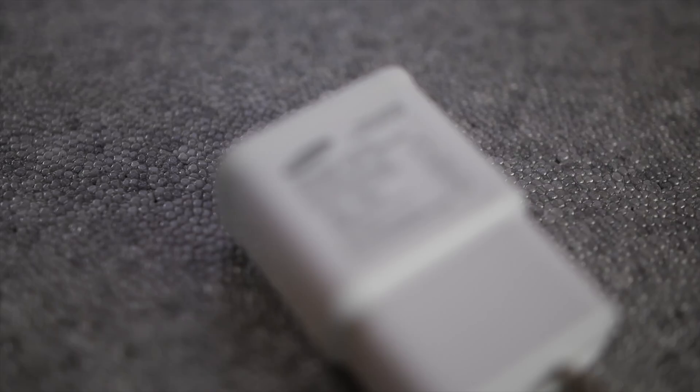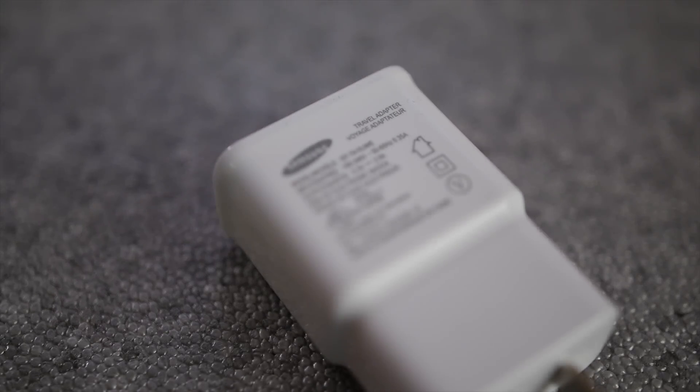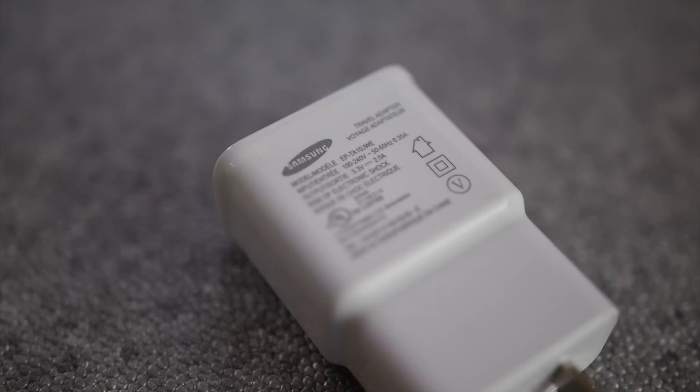So what have we learned from all this testing? For one, a quality charger that matches your phone is actually pretty important. The difference between 13 watts and 9 watts is 144%, which is a pretty significant difference if you're in a hurry. Also, just because a charger advertises itself as a 2.4 amp charger doesn't make it a very fast charger. When you're considering what charger to use with your phone, take a look at the fine print. All chargers in North America must have an input and output certification printed on them — these are exact standards the device must hit and should give you the true story that all of the marketing on the box might not.